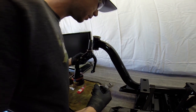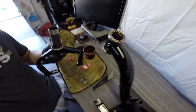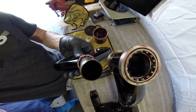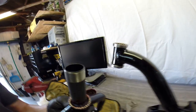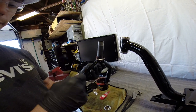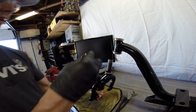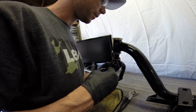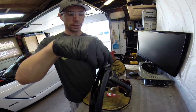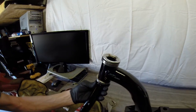Be careful when you're putting your forks through here. If you look directly down in there, you don't want to see a lot of grease hanging over on the edge — that's another reason that causes your forks to come loose. As you're pushing it up through there, grease can get caught on the threads of your forks, and even though you've got the Loctite on there, when you tighten it down you're screwing that grease in — you don't want that. So be very careful as you push your forks up through there that you're not getting grease on the threads. Go right up through there, keep it centered.